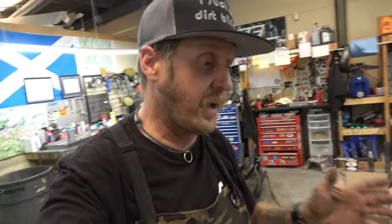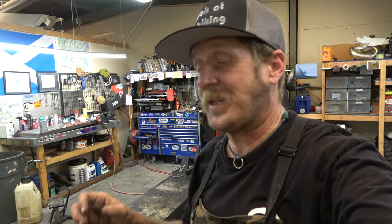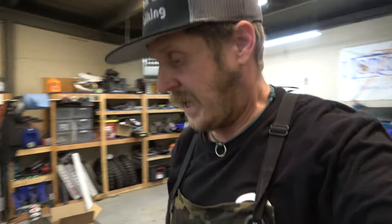The XR 600 is all done. The brake light and taillight situation was just a burnt-out bulb, so I put a new bulb in. The brake light didn't work because the pressure switch had gone out — to test it, I just clipped the two wires and touched them together and the brake light lit up. Put a new switch in, new brake pads, bark buster shields on it — it's all ready to rock and roll. Street legal, ready to go.